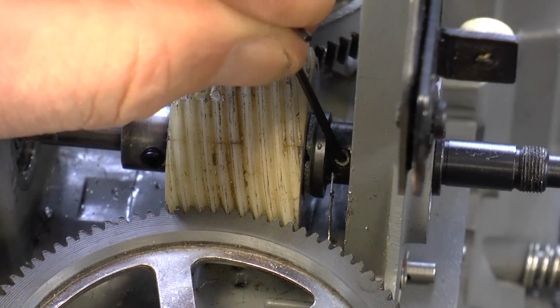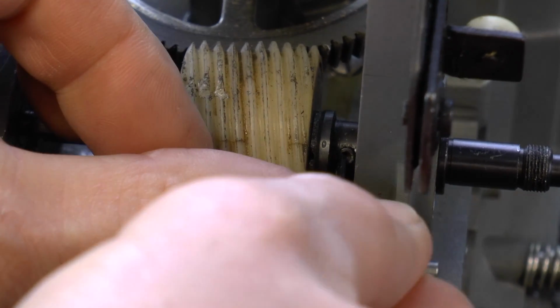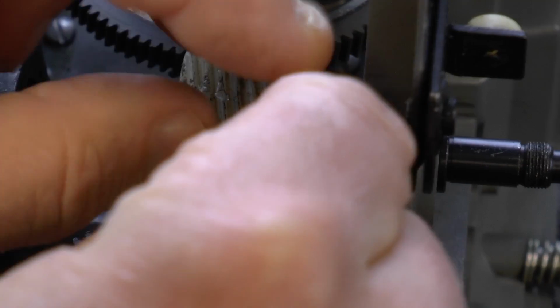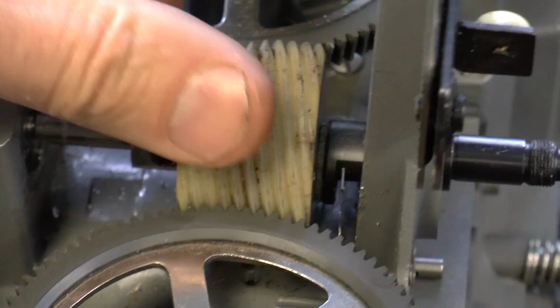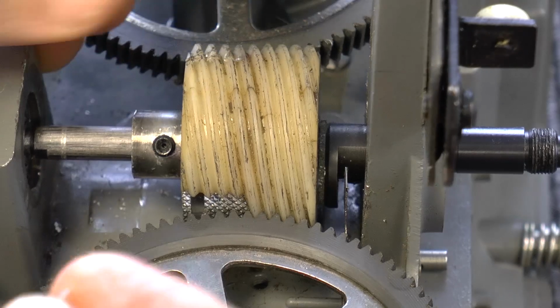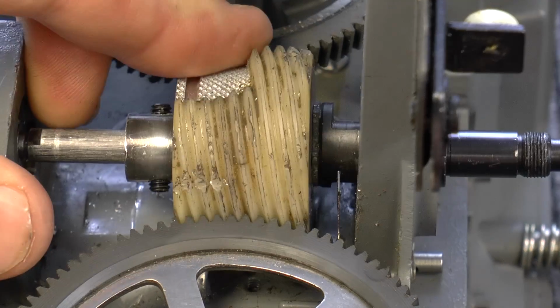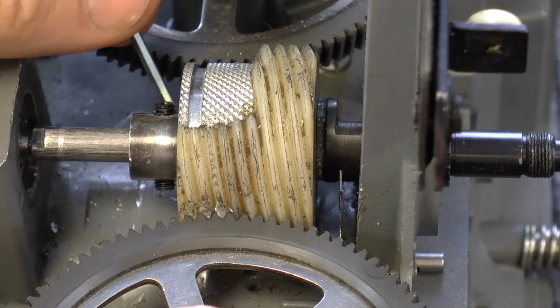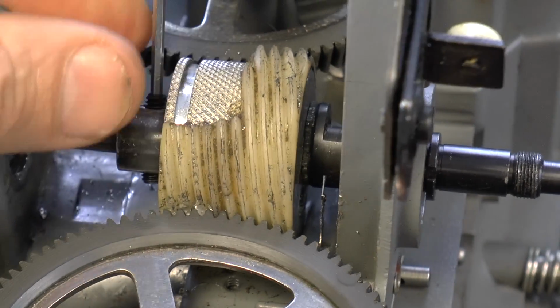So we'll proceed to the next stage of extracting the shaft and the bearing. Observe the grub screw in there. We'll loosen that. Okay, we'll loosen that off, and the 2 grub screws on the worm wheel. One there, loosen him. You can see how all the nylon gearing has rapidly fallen off. Loosen the other one.